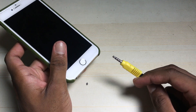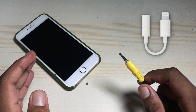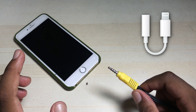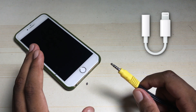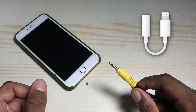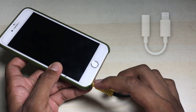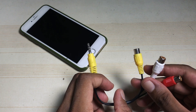If you are an iPhone user, I would definitely recommend you to use the lightning adapter, as it's going to provide you better audio quality. The reason why is because the lightning adapter converts the audio into digital form before sending it to your phone, while connecting directly into your iPhone inputs it as an analog signal.